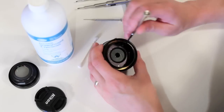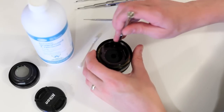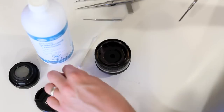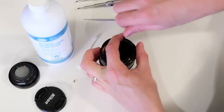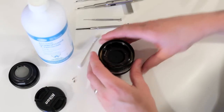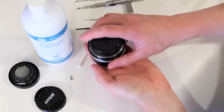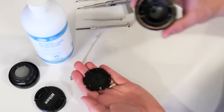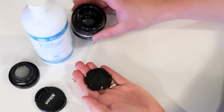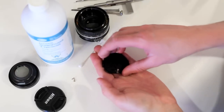Now you'll have these two screws - this is common. You undo the screws. Don't peel that red glue off, because we'll use that to align everything later. There, that's it. Now it should tap out. There it is. Sometimes you'll get a little oil around the outside, but I'll just swab the whole thing.